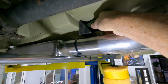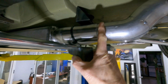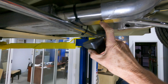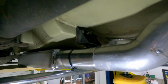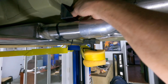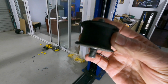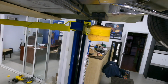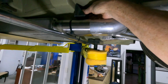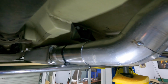So what we're doing there, this will actually bolt on with the exhaust. So there'll be a flange put in here, just having those cut at the moment. So that'll be a bolt-on flange. And then that mount up in there will actually have one of these little fellas, which is a proper exhaust mount, but the load sits down on it. So that'll bolt on to there, probably with a nylock nut. I'll just grab a torch. So that'll bolt to the rail going across there.